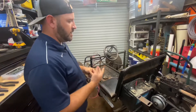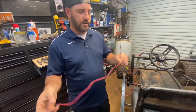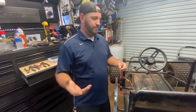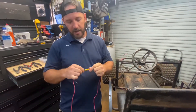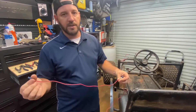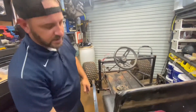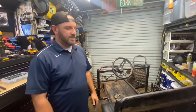If you're working on a project that had wiring done to it previously, one thing you'll want to do is go through and double check all the wires on the cart and make sure there are no breaks or tears in the insulation. These things have a metal frame, so you don't want the power going through the wire to arc off that metal frame, causing a short or causing a fire — worst case scenario. Just skim over everything and make sure all your wires are in pretty good shape. This connector right here holds really well so we're not going to change it. All the ground terminals are good, and there are no breaks or cuts in this wire. Just a pro tip for the future — if you're working on one that had wiring done previously and you're just buttoning stuff back up, double check it. That little bit of insurance can save you in the long run.